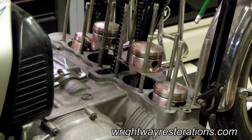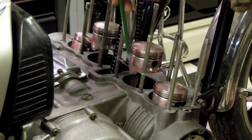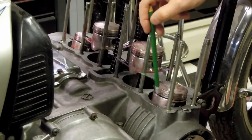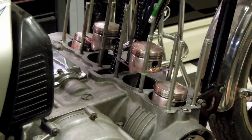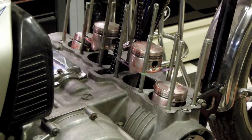As you can see here, I've gone ahead and lubricated all four pistons with assembly lube liberally. There is a possibility of using too much assembly lube, but like in most things in life, you just got to use common sense. I slathered it on pretty good on the pistons and the rings. The crown or top of the piston doesn't necessarily need assembly lube, but it was inevitable in the process of doing the rings and the skirts that it would get on top. I'll wipe some of it off before I put the head on. Use good common sense when putting assembly lube on any moving parts.